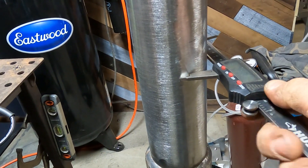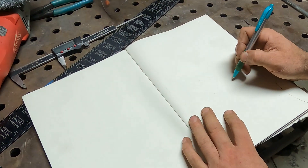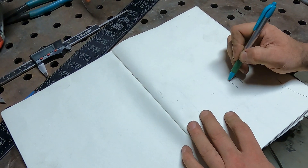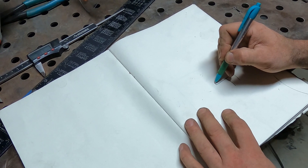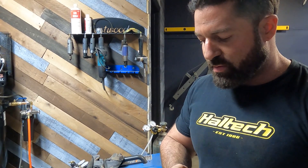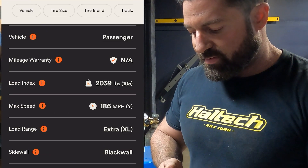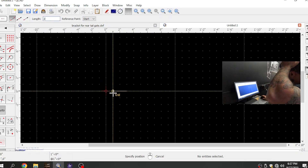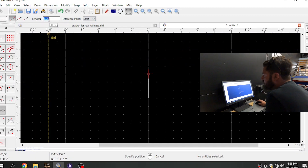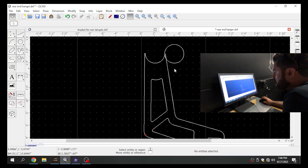The Toyo is 26.4 to 26.5 inches - I'll double check it - and I'll make my measurements in height: half of that right at the center of the spline. I'll do all the measurements for the tube of the rear end and show how I subtract that later. I started this bracket and it's going to hook onto this. My first reference point comes from here to the back side of this tube. I'm going to use a one-and-a-half inch tube and bring this back to be perfectly dead center. That's a three-inch tube. Okay, let's go design. We know my tube on the frame is a two-by-three - that's where the leading edge comes from. Let's look up the tire diameter real quick: Toyo Proxes R888, 305.